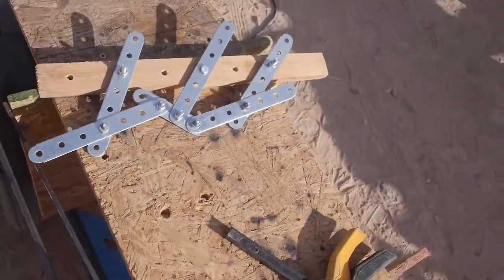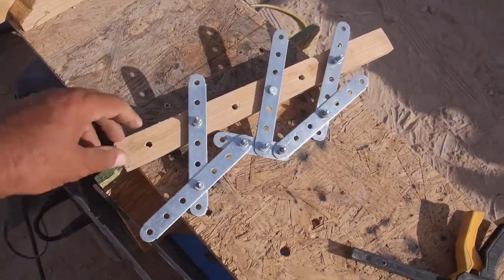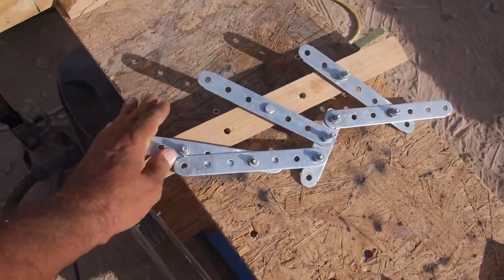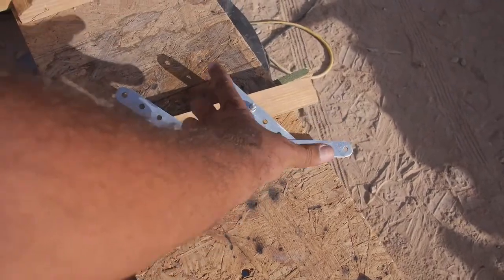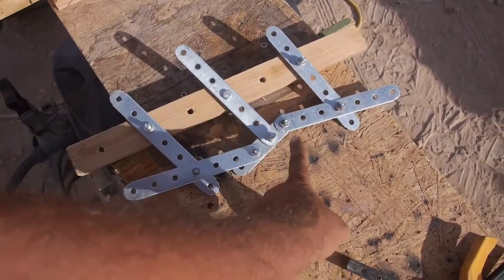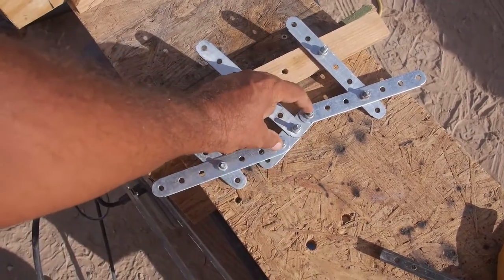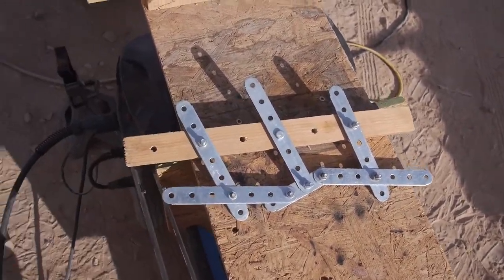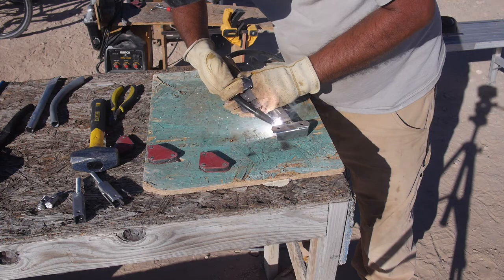The rear wheel is now not tilted to one side, so it even looks kind of straight. The seat stayed the same — it was in the right place, it was just that everything else was wrong. Once I had things level and kind of straight, the next part was figuring out how to make steering linkage for the two front wheels — I think it's called Ackermann or something. The idea is when you turn, like in your car, the inside wheel turns further than the outside wheel. I also made some nice adjustable steering linkage tie rod things.